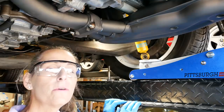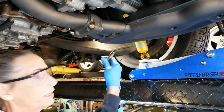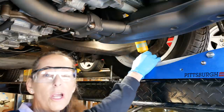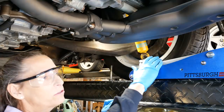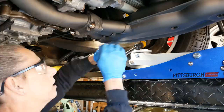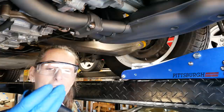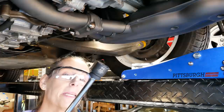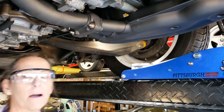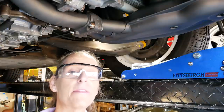The last thing we need to do is jack up the shock here to get it lined up with the carrier and get our big bolt in. It's a lot of pressure on this shock — it's pushing down reasonably hard, so I have to use a jack. This bolt is kind of a beast: it takes 92 foot-pounds to tighten it, and it's a big 22 millimeter bolt too. Holy cow — that has quite a bit. The other side is pretty much the same thing.